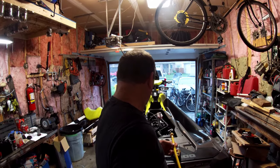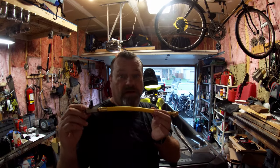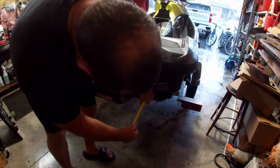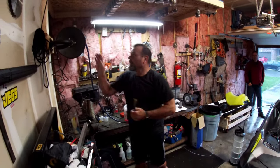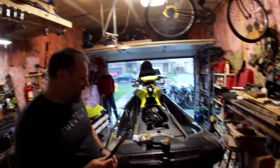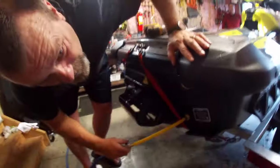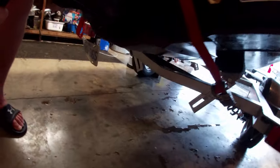While we wait for that oil to draw — as I said, it takes forever — I bought this handy little fitting hose on Amazon for about $29, delivered. I've got my compressor set to 55 PSI and we're going to blow the water out of this thing. The last thing you want is any water sitting in that exhaust in the cold — it will freeze your water box. We'll give it a little bit of air, nice and slow.